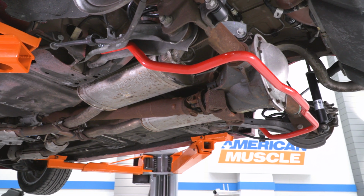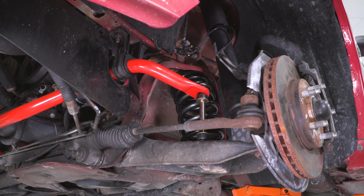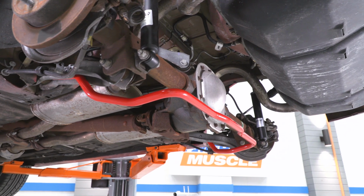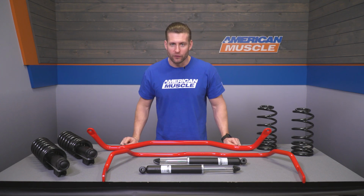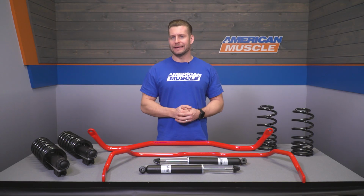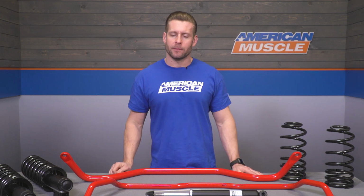But what do you say we talk about those sway bars a little bit more, because again, the Sport Plus kit does include the set of Eibach front and rear bars here. The rear bar itself is two-way adjustable, while the front is non-adjustable, and overall a solid improvement over the bars you are replacing. In fact, you're going to be looking at a 35mm tubular bar for the front and a 25mm solid rear bar. Now the tubular front bar is nice because it will save a little bit of weight compared to a super heavy solid option, but without really compromising rigidity.